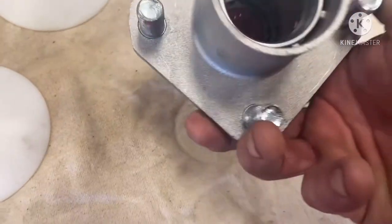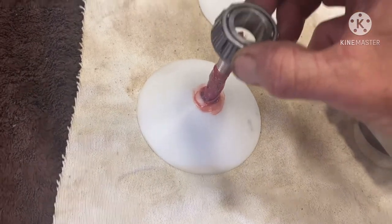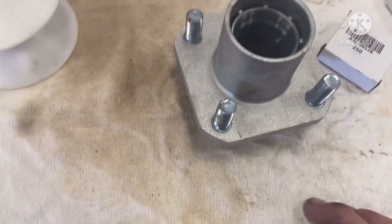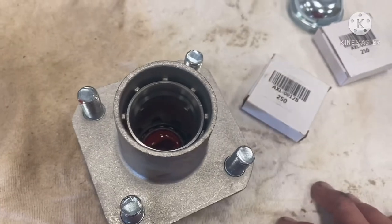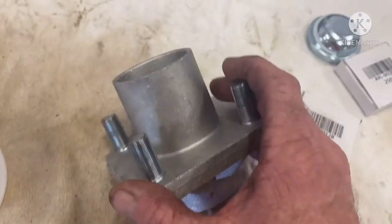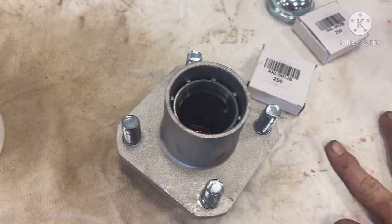On the front side you're going to do the same thing — another bearing, cone facing up, spin it on there, same exact thing. Then you turn that around and flip it inside there. That's also a cone with a taper on the race, and then you'll slide it onto the shaft of your spindle and tighten it down. That's just a short video of unboxing the Red Hawk steel cap hub for a Club Car DS and showing you how to grease the bearings properly and install them. Hopefully this video helped you — thank you.